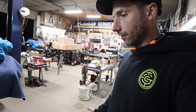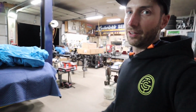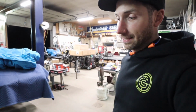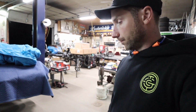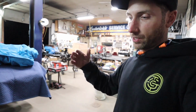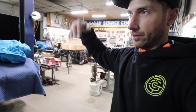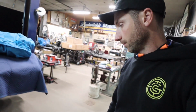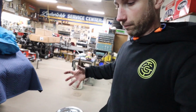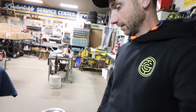fine. And like I mentioned before, all the 165/45s on 15x8s that I've done in the past, I haven't actually needed a bead blaster to get them seated. But a 165/50 I have, because those sidewalls are larger and they usually roll in when they're stacked in the warehouse when these tires are new. So they need that bead blaster to fold those sidewalls out to grab the bead of the wheel to seat the tire.